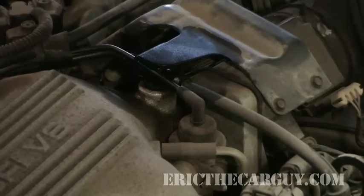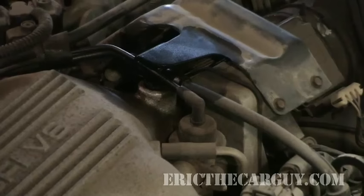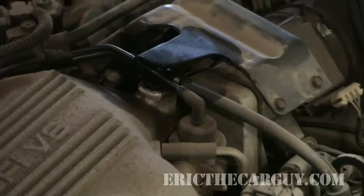Notice the change in the engine? Right here — I can even stall the engine on this one. That shouldn't happen. The complaint on this car was that it would stall intermittently but start right back up — kind of a strange problem to diagnose sometimes, because it's really difficult to diagnose something that's not acting up. So in this case, I'm just looking for everything. Keep an ear out for that high-pitched noise. If you hear that high-pitched noise while your engine is running, and you do this test and you can stall the engine, that's how you find an intake leak.